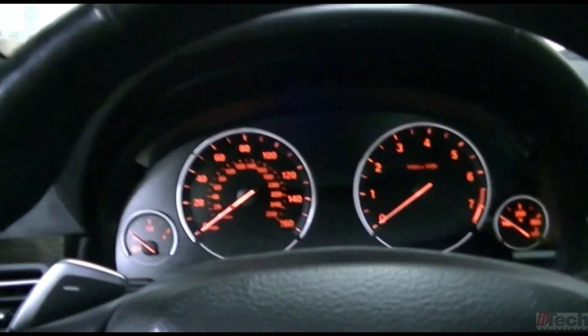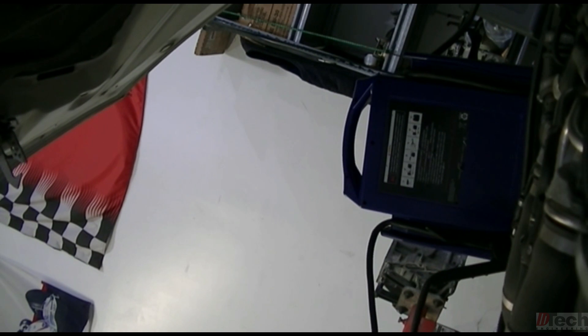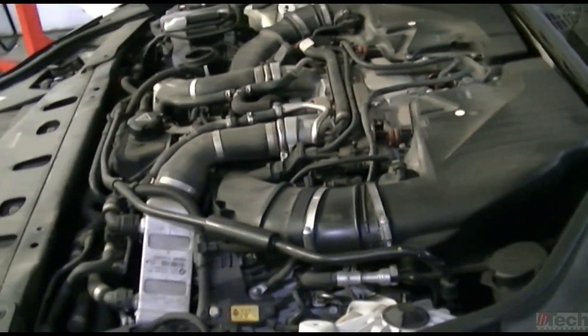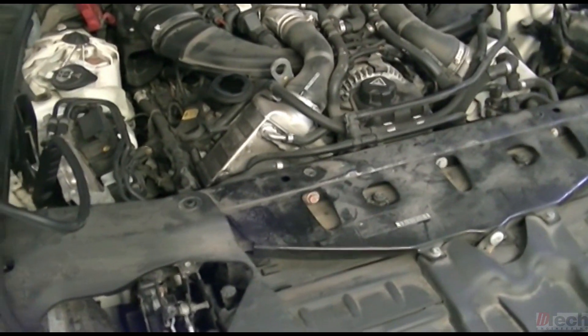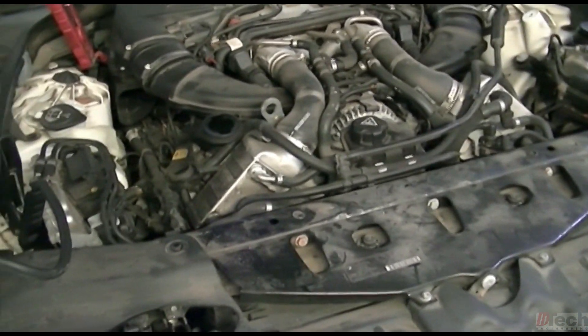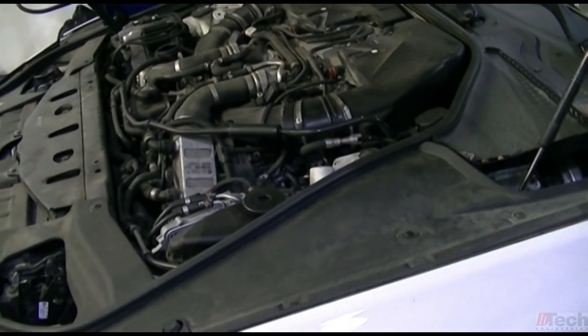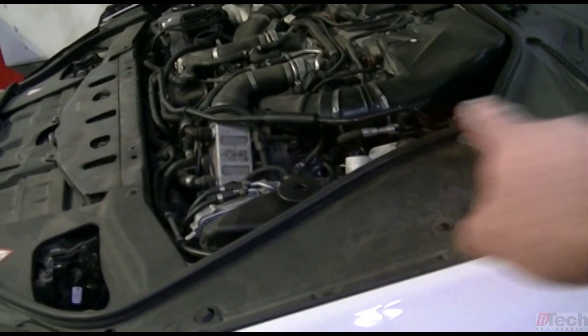As you can see it does actually run. There's no crazy engine knocking or rod knock. You do smell a lot of raw fuel, and yes there is a crankcase leak there, but that makes no difference. It runs real rough and there are no crazy mechanical sounds, which is why I decided to tell the customer we can possibly repair it by redoing the timing — as long as we confirm all those valves are good.